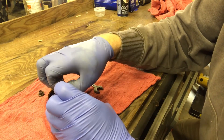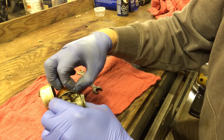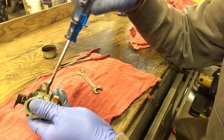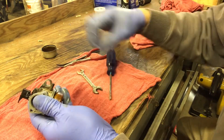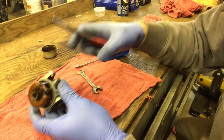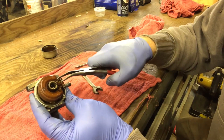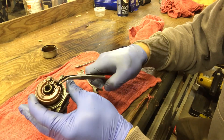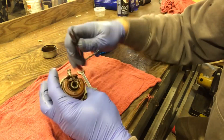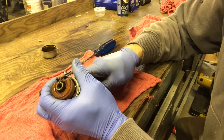Let's get this off without destroying the O-ring. Wow, that is really really bad. I normally screw the adjustment screw in and count the turns so I can put it back to the exact same place, but I can't do that - there's so much gummy stuff in there I probably wouldn't even know when it reaches the end and might damage it. So we just unscrewed it. There's a little pin in here that's got to come out.